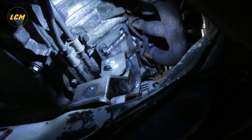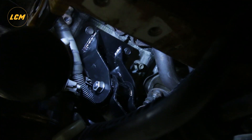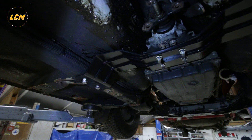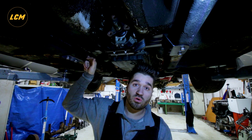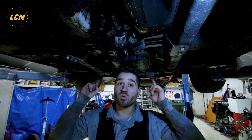This here is the engine mount we designed. As you can see it fits very nicely — there are no clearance issues anywhere and it also looks really good. The finished product will be gloss black powder coat. In these engine mounts there are polyurethane bushings which take the shocks very nicely and are way better than the stock rubber ones. I really like ease of installation, and that's why this gearbox mount has a few nice features. There's room for two exhausts just like on the original one, and the best thing is you can use the original mounting points — so no drilling, cutting, or welding whatsoever. Just bolt it down with the original 1UZ gearbox rubber. On the side there's loads of room for fuel lines, brake lines, and all the things right next to it.